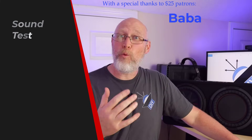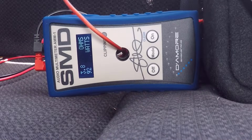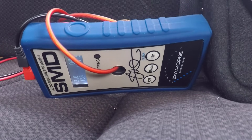Going into it, I don't have really high expectations. When you have a small enclosure, you can either play low or loud, but not both — that's Hoffman's Iron Law in a nutshell. The enclosure is wired at 2 ohms. The amp I'm using can only give about 350 watts of clean power at 2 ohms, so I'm underpowering this just a little bit. As you can see on this portable handheld amp dyno, your daily driver playing regular music isn't going to see anywhere near the power the amplifier could potentially put out. I recommend going with a bigger amplifier — at least 400 watts RMS on a subwoofer like this. These Kicker subwoofers can easily handle their rated power.